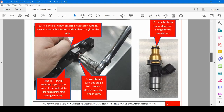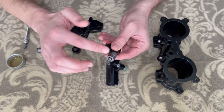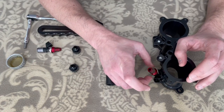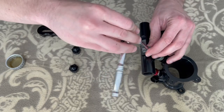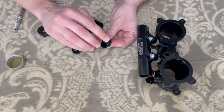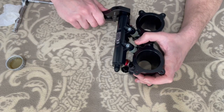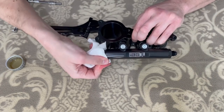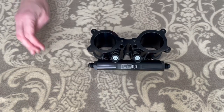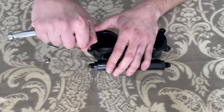IAG supplies spacers and very easy-to-follow instructions on their website. I first prepared the spacers in the fuel rail, then gave a very light dab of oil to the injector o-rings, seated them in the TGVs, and installed the fuel rail over them. I gave the Vibrant Performance fittings a light dab of oil as well and screwed them into place, then cleaned off the excess oil and repeated the process on the other side.